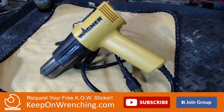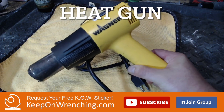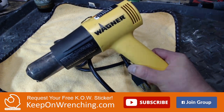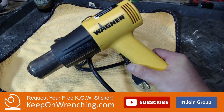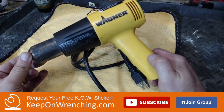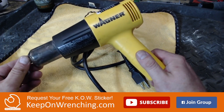Number three is going to be a heat gun, or maybe even a propane torch, but I've found the heat gun to be invaluable. The heat gun is going to allow you to apply penetrating oil onto parts, nuts and bolts, and various items. Heat is your friend — if you run into a sticky spot and something isn't moving, get out the heat gun. Heat moves parts.